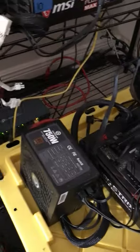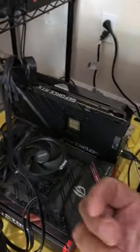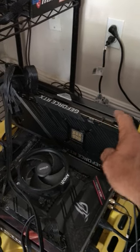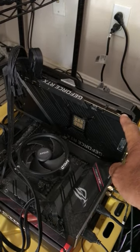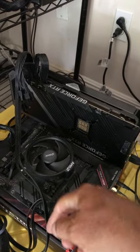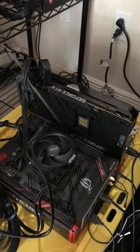Get a motherboard — sorry about the dust — pop in the GPU, have your HDMI cable connected, and run the Nvidia control panel. Reset it to the default factory settings in case you had some overclock settings still active on the card. Then run it, bring up a game like Portal from Steam, let it run for a bit, make sure the fans spin up, make sure it works and doesn't overheat.